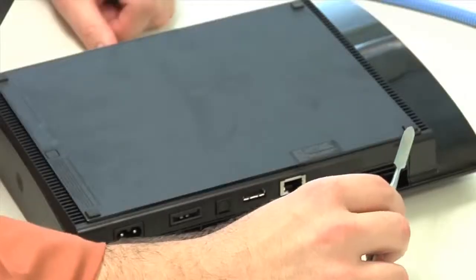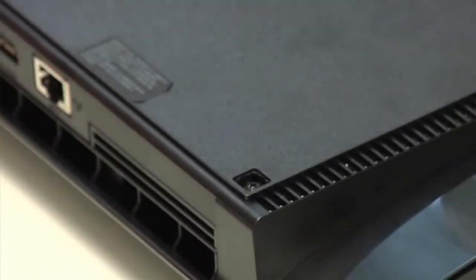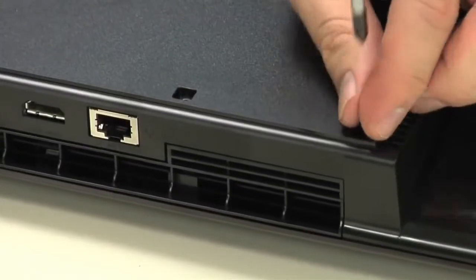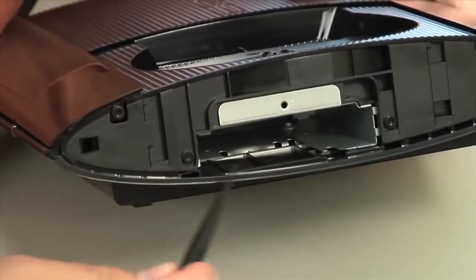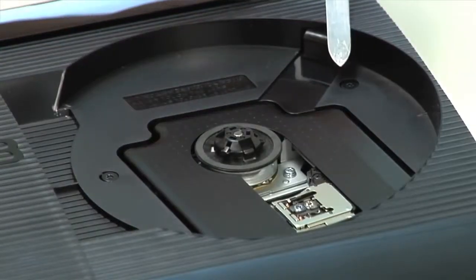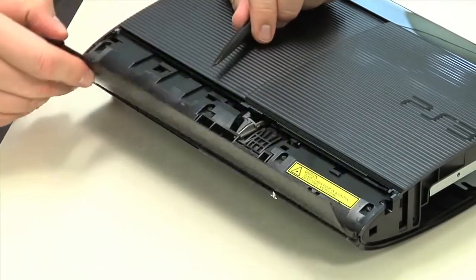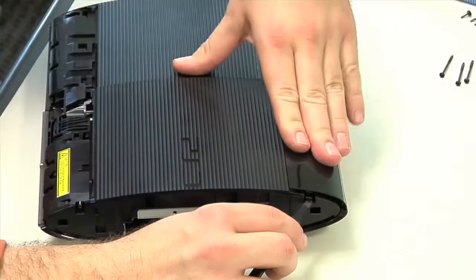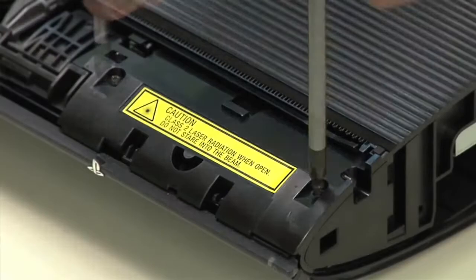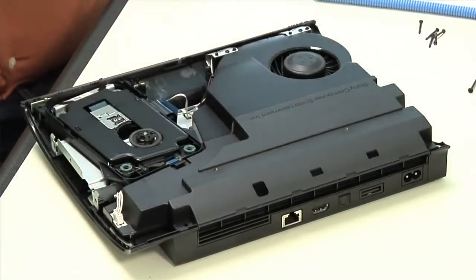After removing the hard drive, I removed three rubber feet that run along the back and side of the unit's bottom, and a void-if-removed warranty sticker. Next I removed the screws that were all underneath, then the three screws from the side of the case where the hard drive is. Two of the top cover screws are accessible by opening the drive door, but to remove the others, you'll need to pop off the pieces of shiny plastic molding that run along the front and rear edges of the top cover. With all the external screws removed, we can pop off the top half of the case and get our first look inside the console.